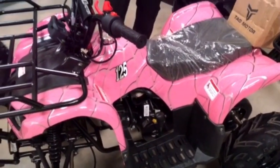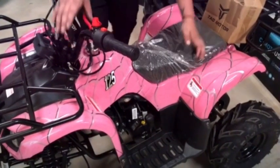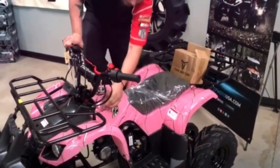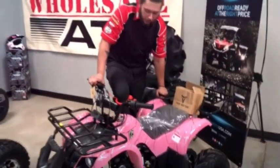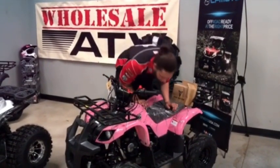I also wanted to tell you on the last video and this video, an oil change is necessary because we do run break-in oil in them when you first buy them, which is a thicker oil. It helps break in and seat the motor correctly. You're going to want to change that oil to 10W-40 ATV oil, 4-cycle. It's pretty simple to do. It only takes 3/4 of a quart.